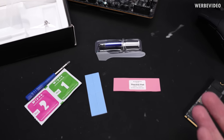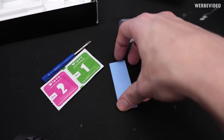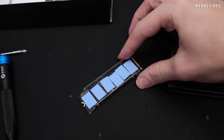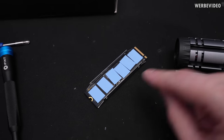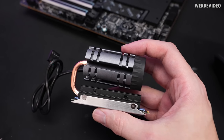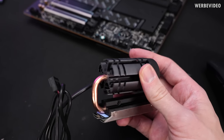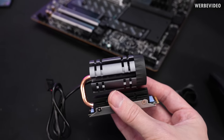You do get a lot of unnecessary stuff with it — thermal paste included even though the manual states to use thermal pads. The included thermal pads are oddly segmented into multiple pieces when one large pad would make far more sense. They also advertise a 'patented angle adjustable structure,' which turns out to mean you can loosen two screws in the heatsink and shift it slightly left or right to make space for other components — interesting, but not well explained.